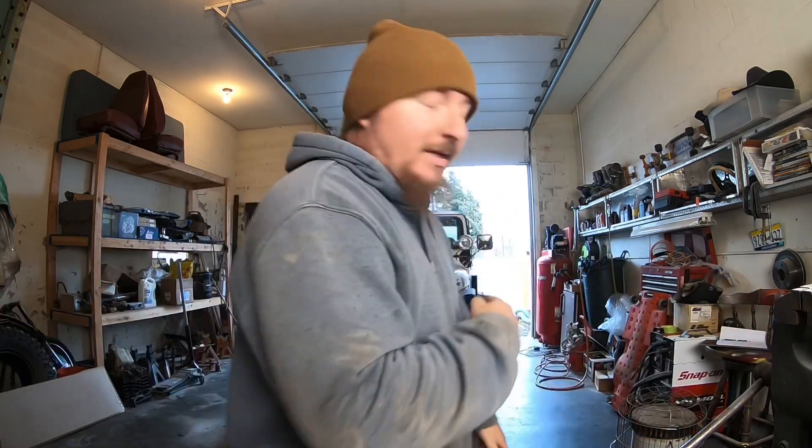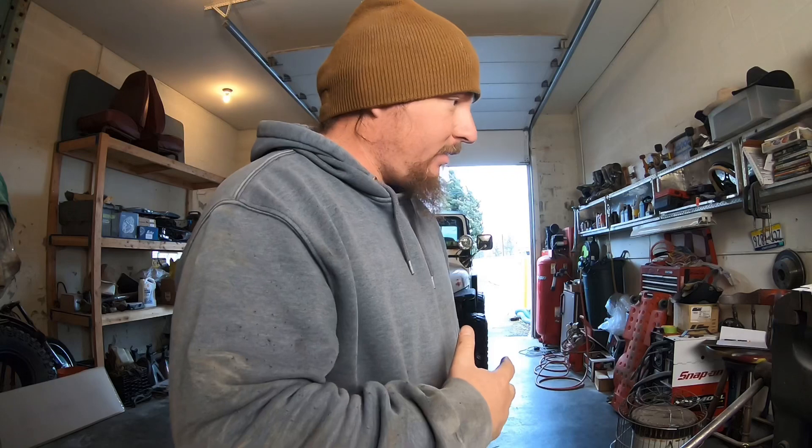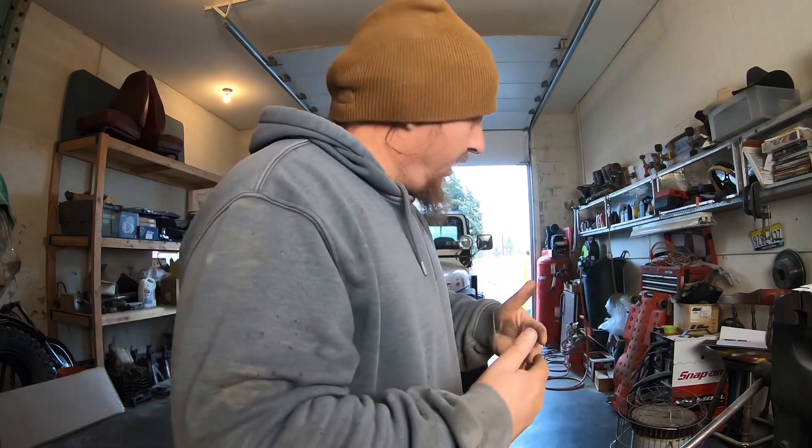Wow! Freaking amazing. I mean, obviously driving with a track bar is way better. I would have to take it off-road and disconnect it to see how well it does. I'm going to assume, just by the technology and the way I looked at it, that it's going to perform quite well. I think it's going to articulate pretty good, as long as you have the track bar allowable to slip — meaning you're going to have to loosen up that locking bolt to allow it to slip. Anyway, I can actually drive mine down the highway now and not have to worry about the wind pushing me off the side. So I'm over the moon about this. JKS, great product. Keep it up. Thank you. I'll see you guys.